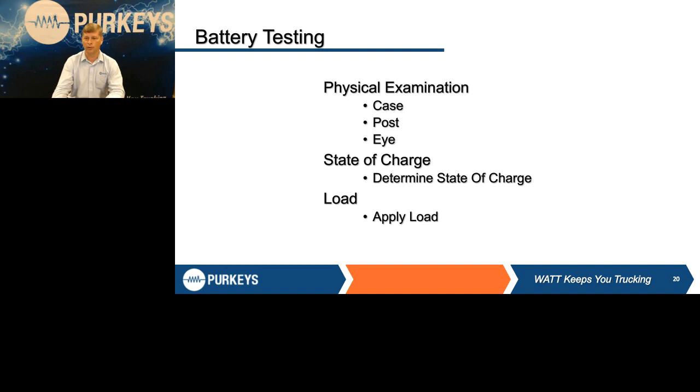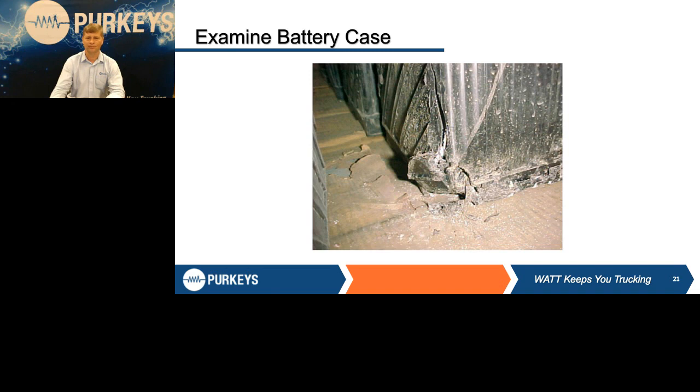So if you get in there with an impact, I don't care how worn out it is, we'll only use them to break it loose, you're going to upset that stud that's in that lead pad, and you're going to cause a high resistance contact. So avoid power tools. State of charge, put a quick voltmeter across it. Are those batteries at a high enough state of charge to test them? And then you're actually going to load test them.